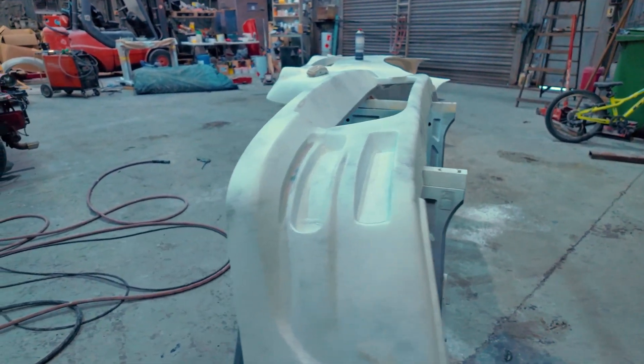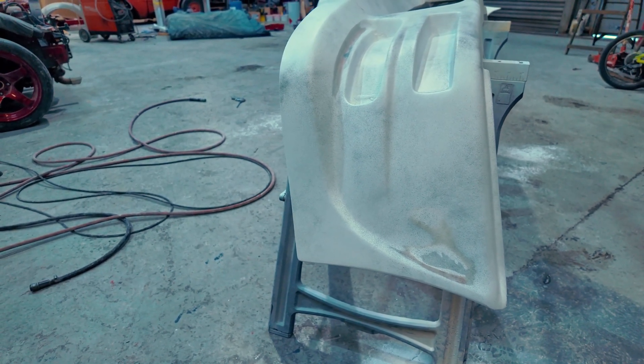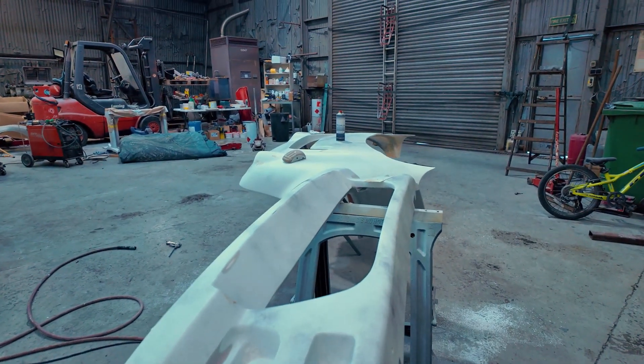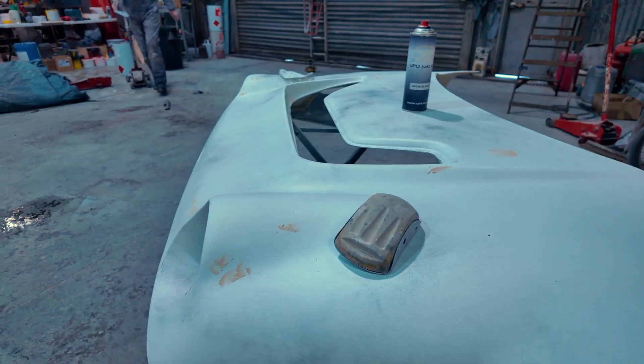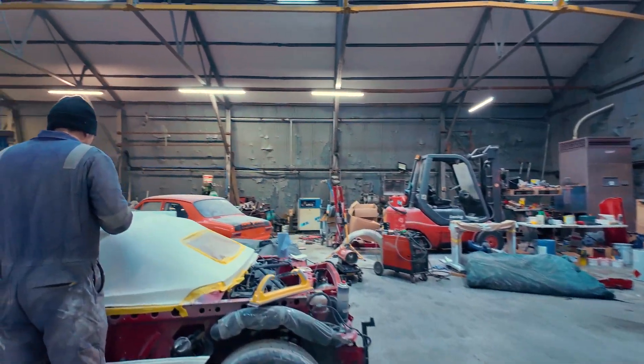Back of the garage, it's Monday. We're a little bit late getting started — Jonathan's fence blew down at home so he had to go and repair his fence. But this is where we're at: got guide coat on there, just rubbed this little bit before I got the guide coat on because it was sitting high. I don't know what's going on with my camera — it looks blue, everything looks blue. Cubes was messing about with the settings the other day, I don't know whether it's that. Got a bit of filler in there because we need to get that bit, and once that's rubbed back I should have that alright. Done the edges on the bonnet — stats ready to rub the full thing now, and I've not really done anything on the clam at all, so Jonathan's doing the roof.